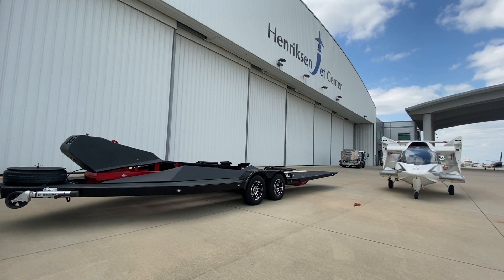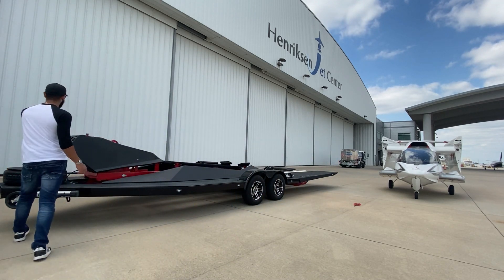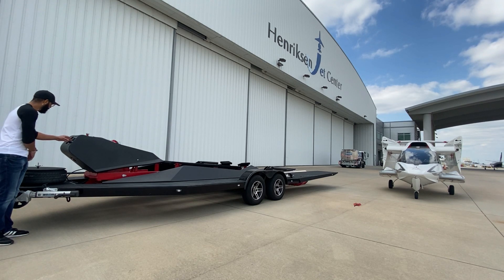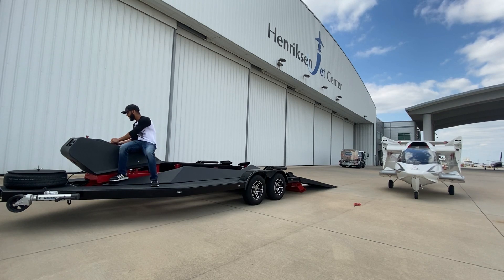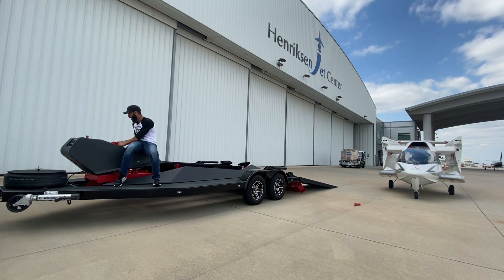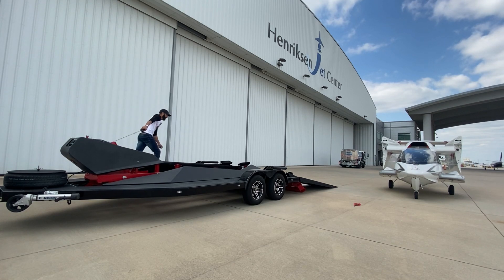Each of these straps has a buckle that you pull, and now I'm ready to put it on the trailer. First thing I'm going to do is drop the ramps on the trailer — there's a control unit over here that you can use. Drop the ramps, and then I need to get the winch cable out. There's a pin that holds the cable in — remove the pin and it is free. You can unlock the winch and run it down.